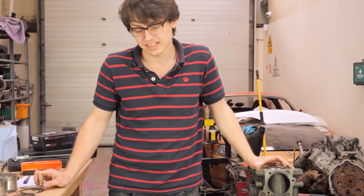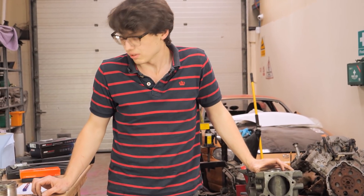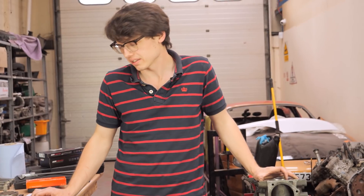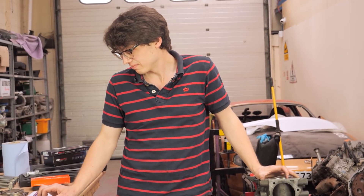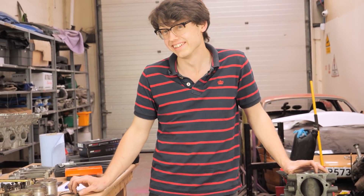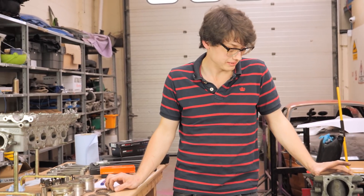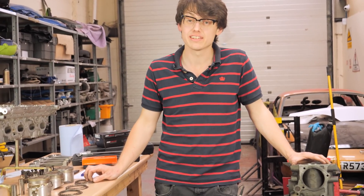We've just finished checking these NPR rings. The gap is slightly larger than I wanted - it's only one thou larger on the top ring, and it's four thou larger on the bottom ring, which is a little bit more annoying. But they are consistent across the board, which means there's no need to gap anything in this case.